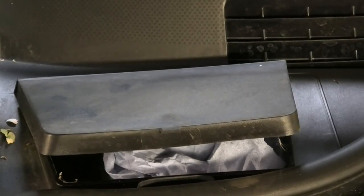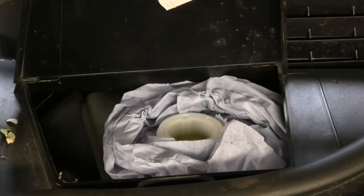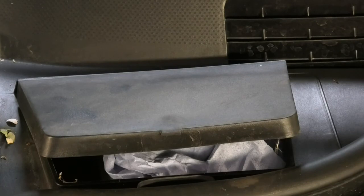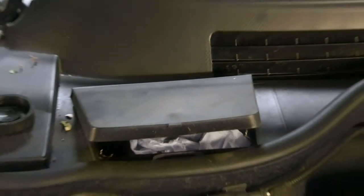So before driving the car or anything, always make sure you press the brakes first until they get nice and hard. Now you may be able to notice that the fluid has gone down a bit, but it's still a bit high in this situation. So I'm gonna need to take a little bit of that fluid out to have it on the max. And that's pretty much it.